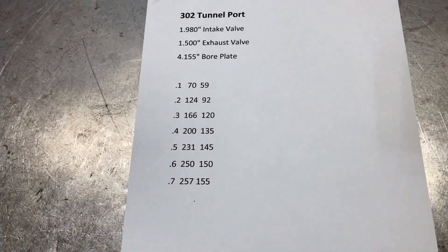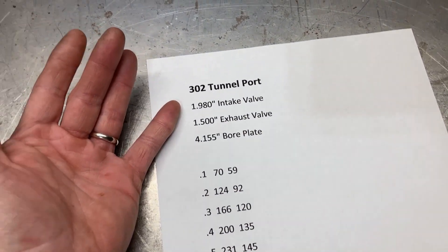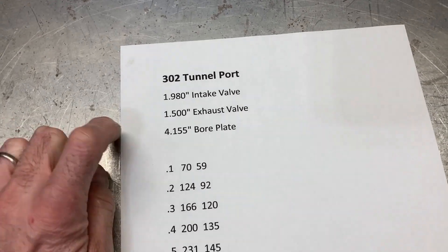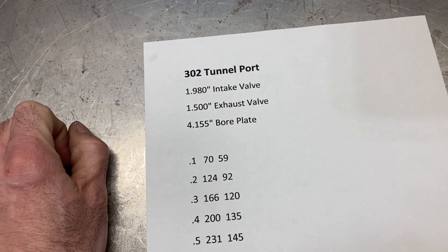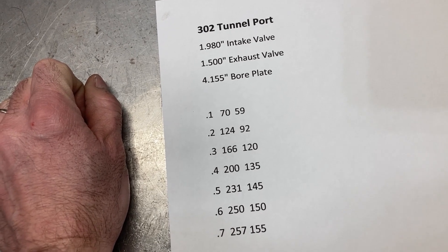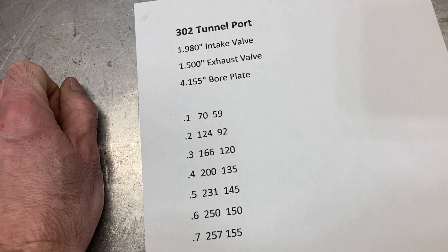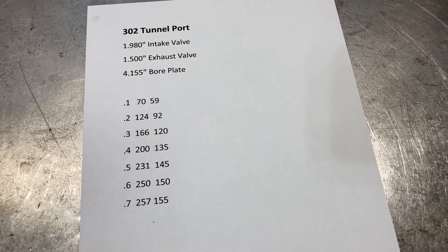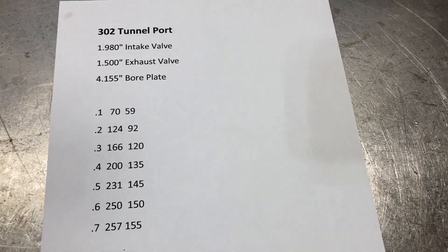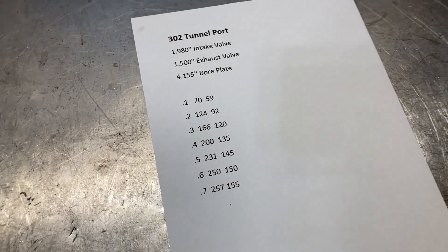Here's what we are working with today. I don't have a ton of room for a lot bigger valves, so I think we can probably do maybe something like a 2.02 or 2.05, and I think we might have room for a 1.600 exhaust valve. We're going to go with probably a 7mm stemmed titanium valve and get them as light as possible. That'll help us with spring pressures, because on something like a road race motor where you want longevity, you don't want 700, 800, 900 pounds of spring pressure — you want to keep that on the downside so you get some longevity out of it.